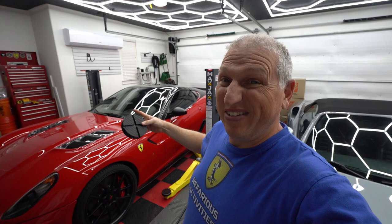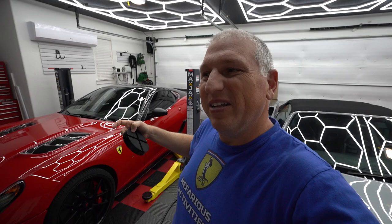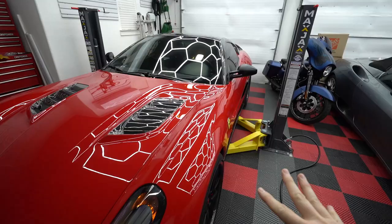This is a pretty good test, because that's like a 4,500-pound car, and this is rated for 6,000 pounds, so we're putting it up near its limits. Obviously, we're not going to be lifting up my truck or anything, but pretty much most cars we could lift up, which is all I really care about. Okay, jack points are in the right spots. Get the pads on. Okay, push the magic button, and we'll test it real quick.